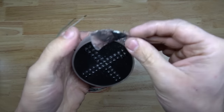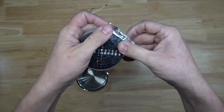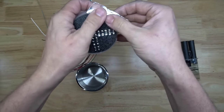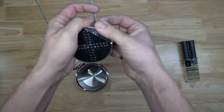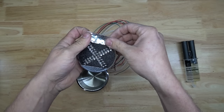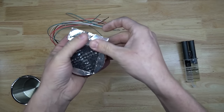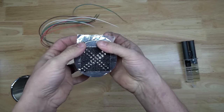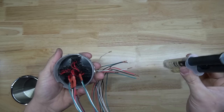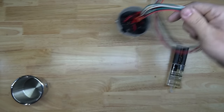And then all I'm going to do right here is just put a little bit of this tape on the edges, because I'm going to use some two-part epoxy to adhere the edges. So this is just making sure that the alignment doesn't come loose while the epoxy is being applied. Once the epoxy hardens, we will take the tape back off. All right, so all I gotta do now is mix up some epoxy, adhere it on the insides, and this should be set to start curing.